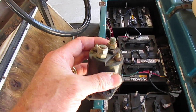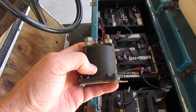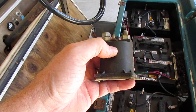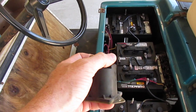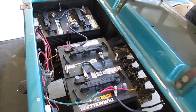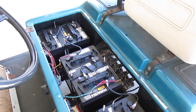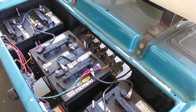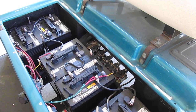The problem I found is that after riding these golf carts for several miles or so, these relays are on continuously, which causes them to get hot. I've taken one apart and found that the plunger gets tight inside — the coil actually swells a little bit and locks the plunger down inside the assembly, preventing it from making contact with the two studs. When that happens, the cart stops working at some speeds. There's also one relay — the first one closest to the right-hand side — that energizes first to enable all the other relays. If that one burns out, you're dead in the water.